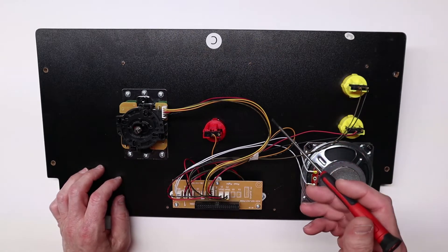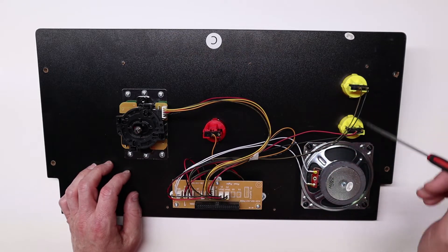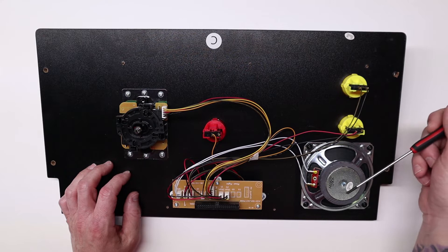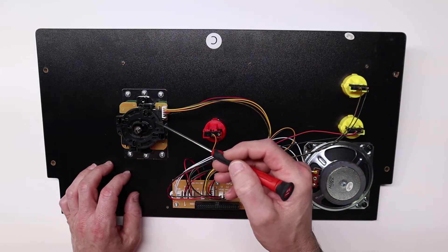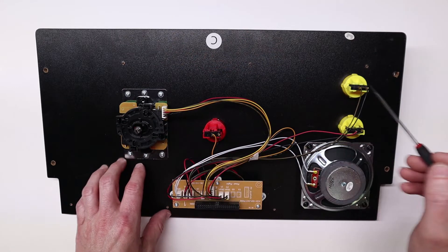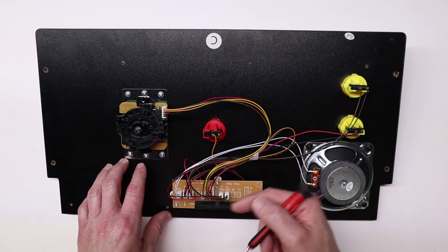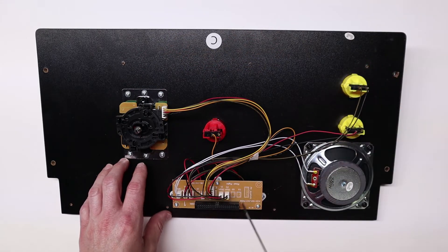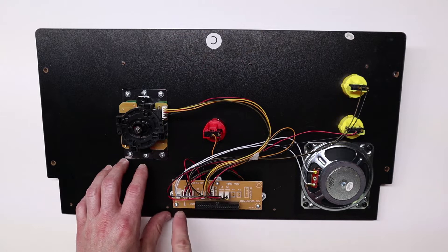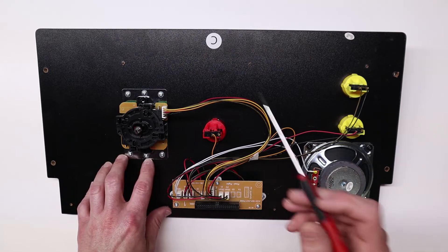With that cover removed, you can see there's really not a whole lot going on on this control panel. We can tell right away there are three micro switches — player one, player two, and then the fire button — your speaker down here, and then you have the joystick, which is just two other micro switches interfaced together with the joystick actuator. All of those components come back to one PCB, and then that's all tying together into a ribbon cable connector which goes out to the actual unit itself. There are also two slide switches underneath this PCB: one is your power switch on and off, and the other is a three-position switch for volume control — off, low, or high.